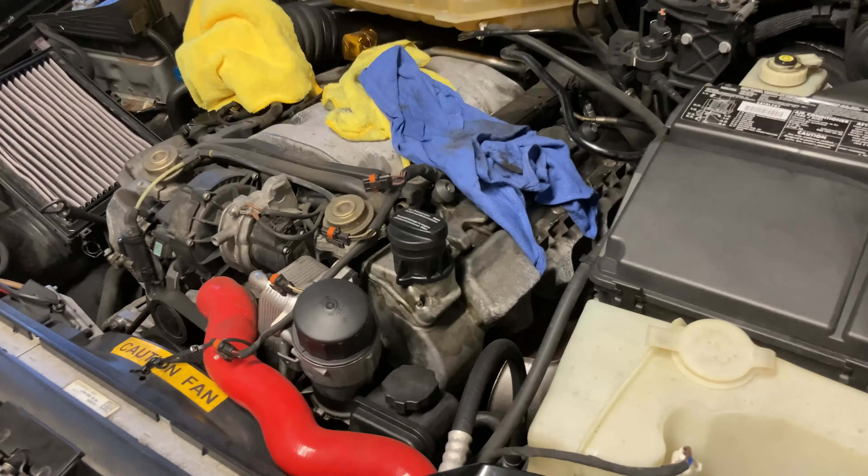I'm going to brush around here one more time, take off the two rubber hoses, and then snake this thing out. The valve cover is officially off. I've just been going around wiping down the edges making sure it's all clean. Everything looks good — the only weird thing I'm seeing is this one rocker arm right here which looks like probably just grime. The rest of them look good, how they should for the most part.